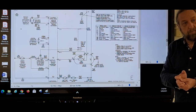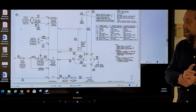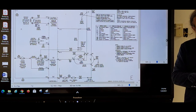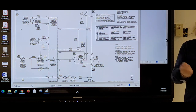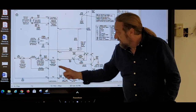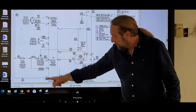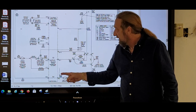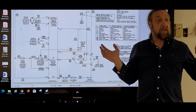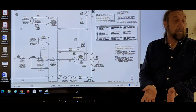Okay, you want to test for, like, at that motor relay. Can we test for continuity at the motor relay? For that motor relay to close, it needs to be energized. There is a way to unplug those wires, but if it's on one big plug, J42 and J41 is on a plug J4. There might be other components on J4 I don't see, but you might disconnect something else. Sometimes it's one big plug. So let's just say you can't unplug it, because if you unplug it, you disconnect power to the whole board. Now the board don't light up.